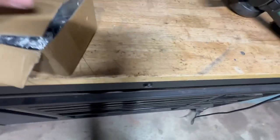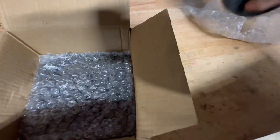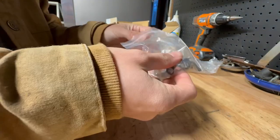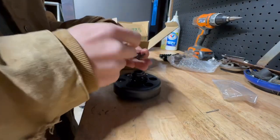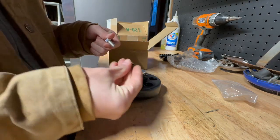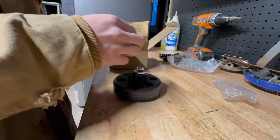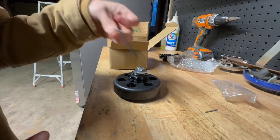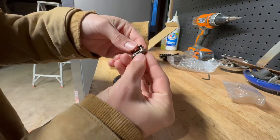If you want to put on a new clutch you have to buy yourself one, so I went over to Amazon and bought this thing for about 30 bucks shipped to your house. It comes with your clutch, a nice clutch, with your keyway inside. I used this one on the other go-kart too and it works perfectly fine. What comes in the hardware: you get a big washer to put on the shaft, then a lock washer and your bolt. I don't know what this other thing is for — if you have a clutch like this and you know what it's for, tell me in the comments — and then one of these master links for the chain.